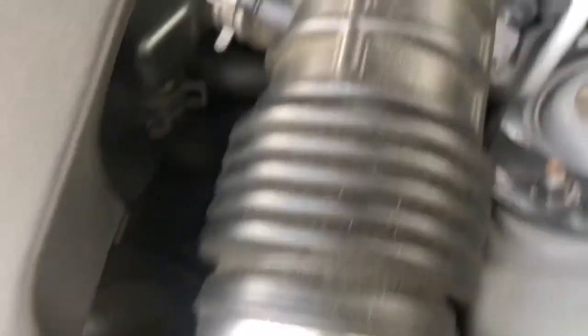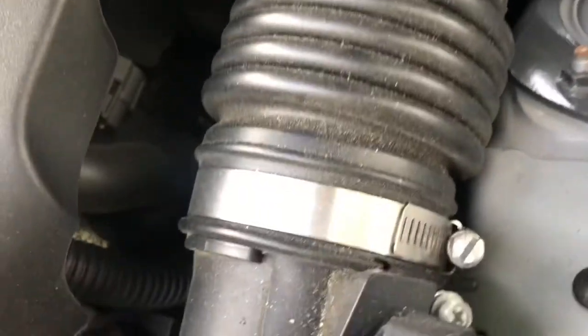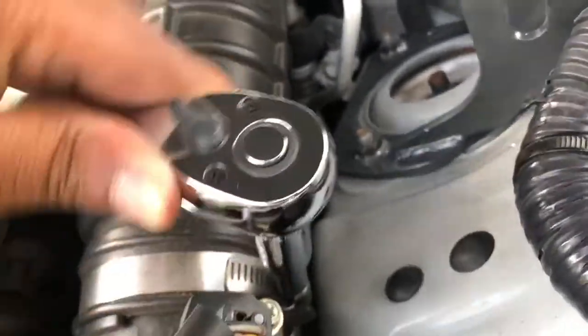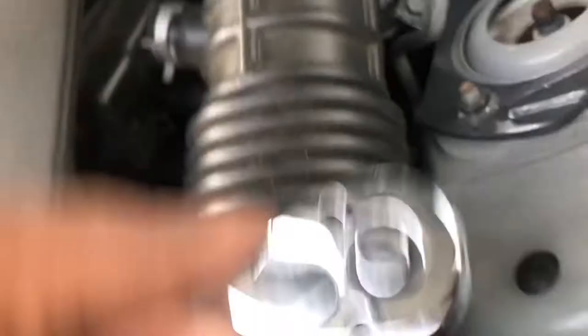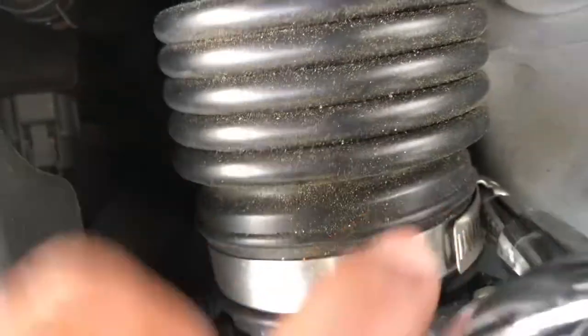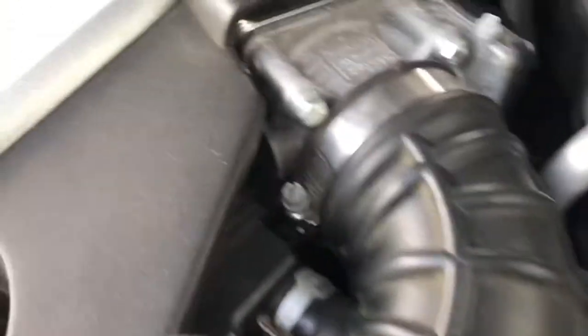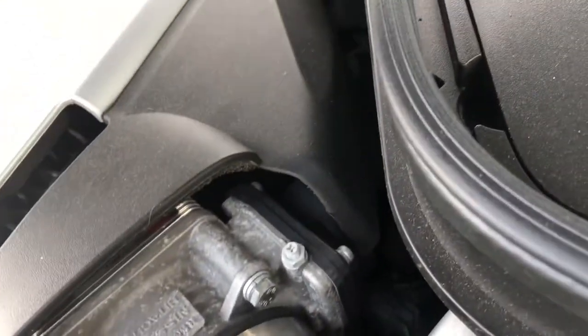As far as here, you have a bolt — actually an 8mm — so get your wrench. With the 8mm you'll see it should be loosening up at this point. You also have one right up here, go ahead and take that one off as well.